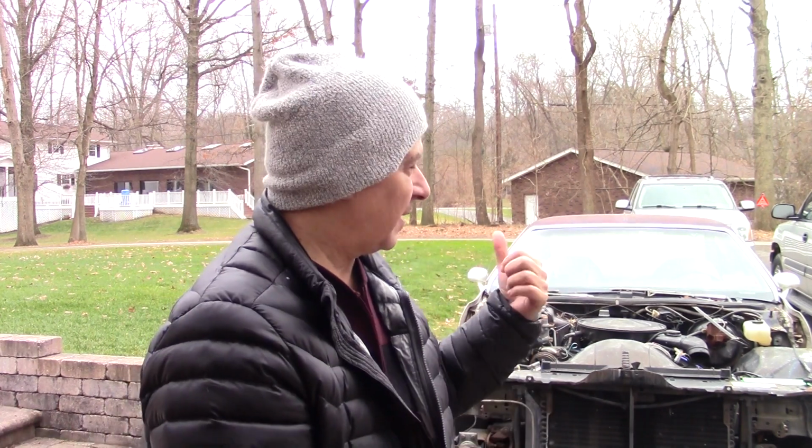And we'll see. I have a 4L60E transmission left over from the Escalade. The third, fourth clutch is burnt, but if you watch enough videos and get the right manuals and tools, that's not a hard task to rebuild those. So get a controller for that. I don't know. We'll see. That could be down the road a little bit.